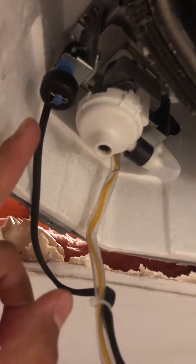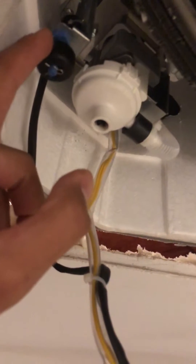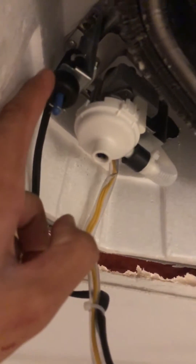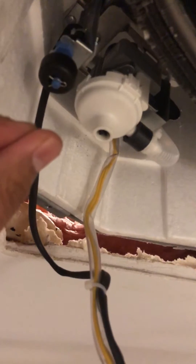I figured out why it does not work. The idiot at the factory that put this together stuck this donut on reversed. There's a little magnet at the top of this donut that, when this goes up, causes a switch to close. It was just upside down, and that's all that made this machine not work.